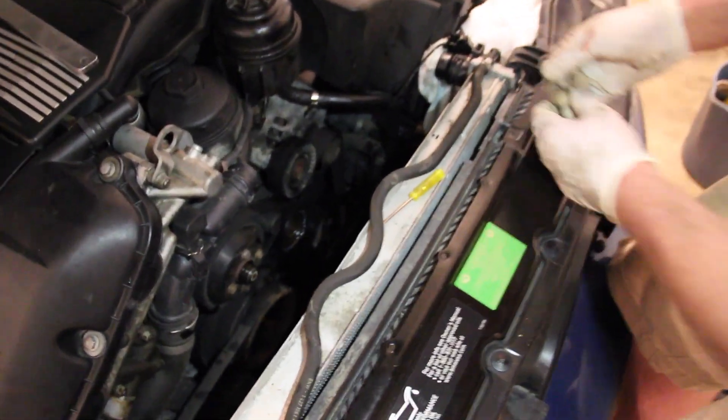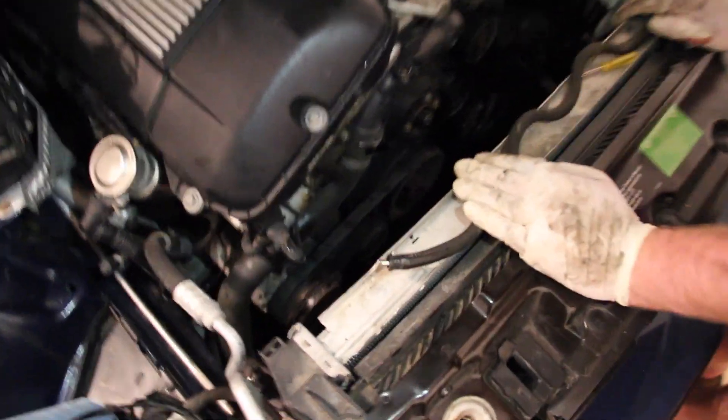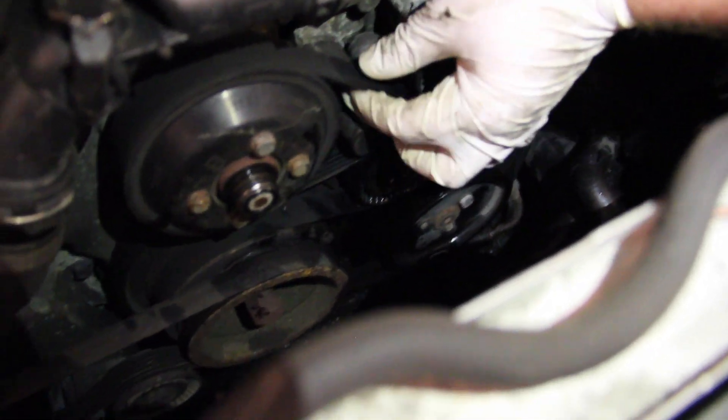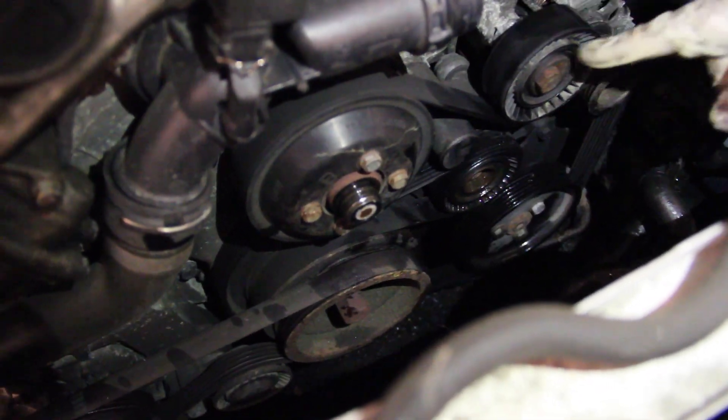Ryan found out the best way to remove these clamps is to take a pair of wire cutters or something strong, stick it in there, cut the top, and work them off. I'm going to replace at least that one with a band clamp because it's easier. Now you can see what we're looking at — we're replacing this bearing here and that one there, and then the belt itself. That's really all we need to replace. This is the one making a lot of noise in my case; this one also tends to make a lot of noise, so I bought a replacement and might as well do it.